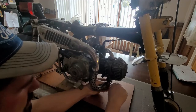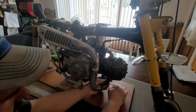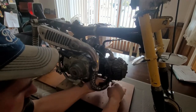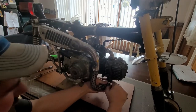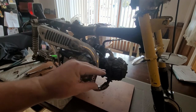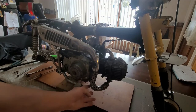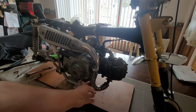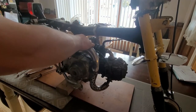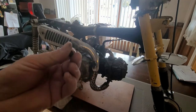That feels like it's tightening up nicely. I'm happy with the tightness. You get your two bolts down bottom with that crush gasket — if I pulled this back apart it would be flat, but I can tell it got hit. After I put the tires on I'm going to take my mallet and tap right here on the back side to take the stress out of it. Then I'll put a nut and washer on the back using a regular 10 millimeter, snaking it through the other side.